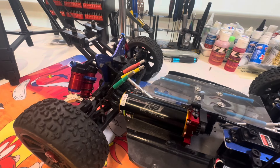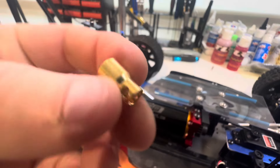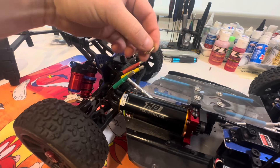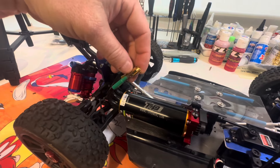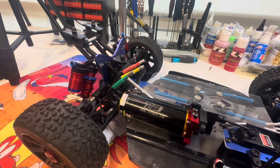I've got these here - they're 8 millimeter female connectors - and I need to solder them onto these wires here, then put heat shrink over it. I've also got the wire here that I'm going to be using - I'll show you a bit of comparison.